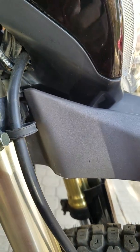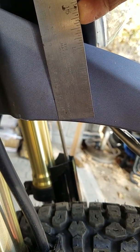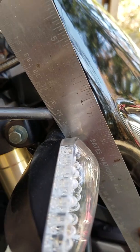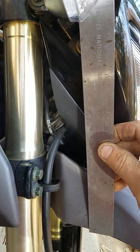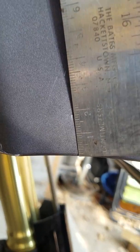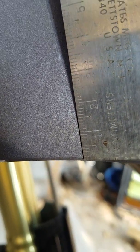There's my little mark from where I had it mounted, to give you guys a reference point so I can match it on the other side. I'm going to take a ruler here and rest it against my blinker, kind of perpendicular to the front fork. I'll use millimeters so I'm not giving you fractions of an inch. If we line the ruler up with the bottom of the fender here, it looks like 19 millimeters up.